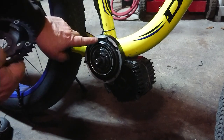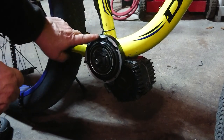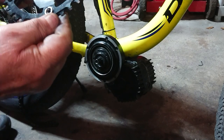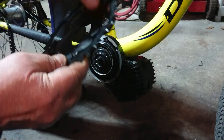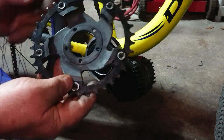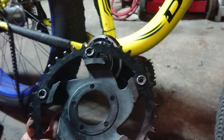What's going to give — this aluminum housing or these hardened steel bolts? The aluminum housing is going to give first. That's why it's ground down to a perfect circle. The bolts are basically fine — they're just shinied up a little bit, not actually ground down. Just so you know, if you get one of these, now you'll know. Hope it helps somebody. Thanks for watching.